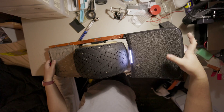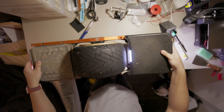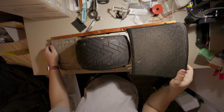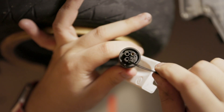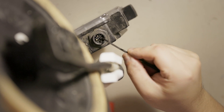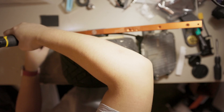This GT is dead. Last time I brought it through rain, even though this whole board is badgered and has a cable retention clip installed, the motor plug still somehow got shorted. You can see this pin is sooty, and on the controller side, half of this phase wire pin is gone. I'm pretty sure water got in here and shorted something against this pin.